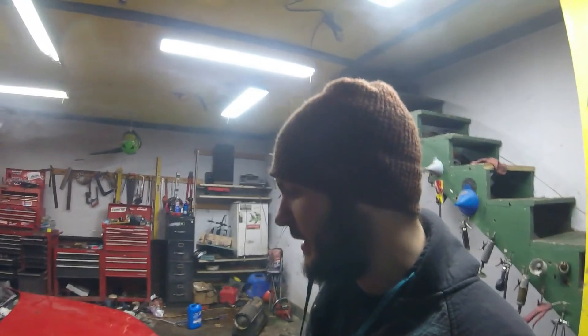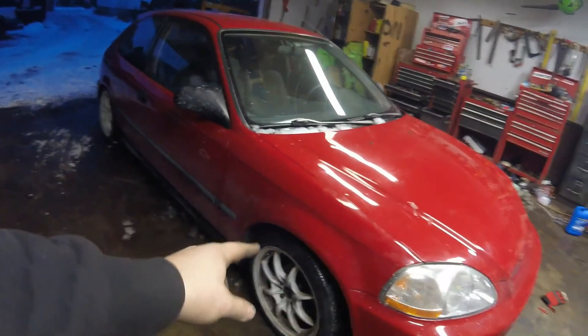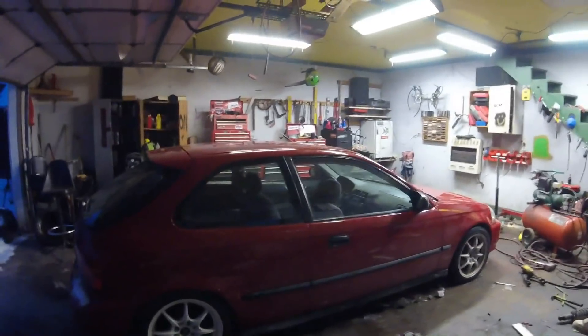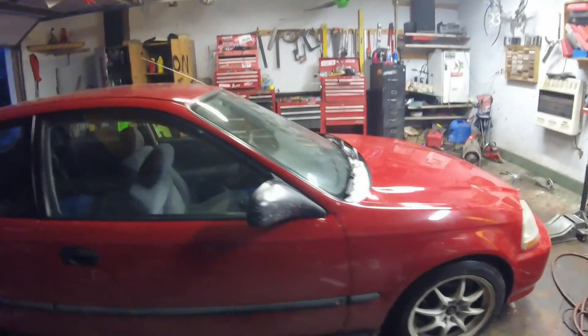Take this brake thing off too, it's annoying. Alright guys, we got the car back on the ground now and we're about to take it for its first test drive and see how these new coilovers ride. You can see the front is almost maxed out and the wheel gap is like a half inch higher in the front — it's almost bottomed out. I think these coils might actually be for an EF, and they just give you the little spacer to convert it, because EF strut forks are actually shorter than EG and EK.